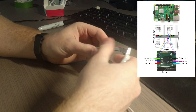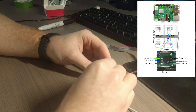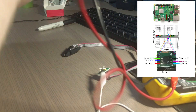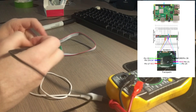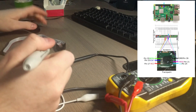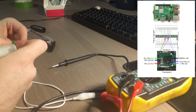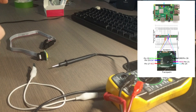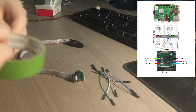After all that, turn off and unplug the Raspberry Pi. I used a multimeter to find out which wire is red on the SOIC clip. I was checking the Chinese clip's wires for continuity and also checking the direction the clip was supposed to face — I read reviews that the clips came backwards, and it's always good to test for yourself. Then I labeled the jumper wires.